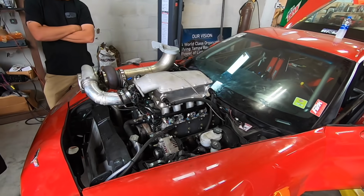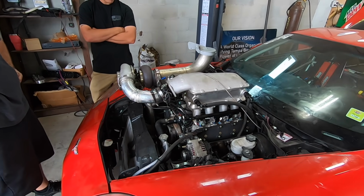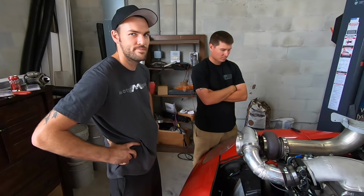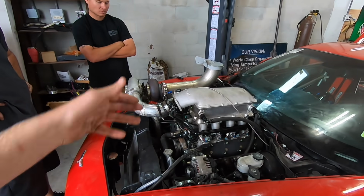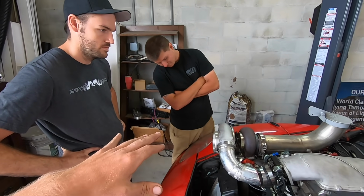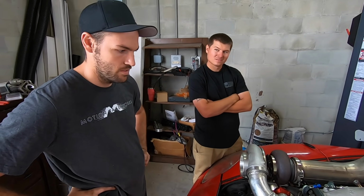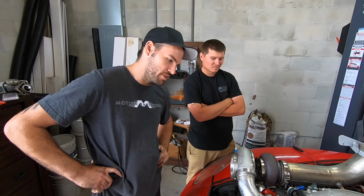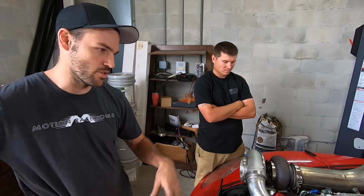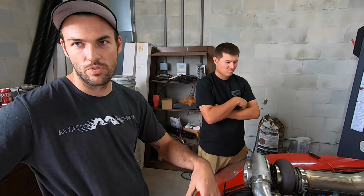We're gonna have to change the tipping on the throttle because I saw when you revved it, it just choked itself. Yeah. A lot of tuning adjustments to be made, but once it's wide open throttle and that Holley starts correcting, we're good to go. So I think we should do a couple pulls at the Freedom Factory Friday and then just send it on the track and start on low boost, maybe 60-foot hit, eighth mile, then quarter mile. All we need to do is just do a couple like 330 rips on the tune-ups we have. Yeah. And just check a plug and make sure everything's the same and see if it wants more or will take light.